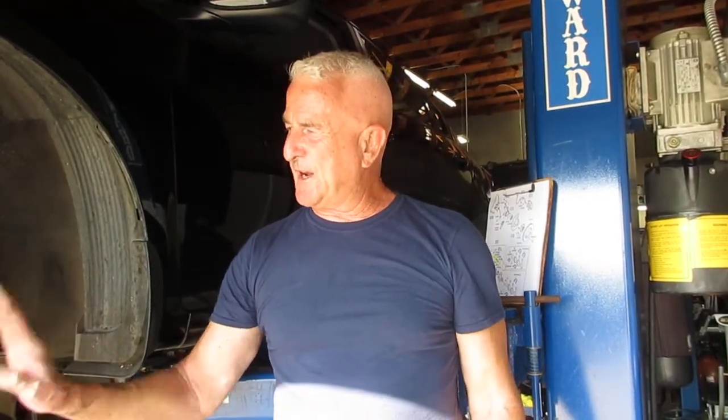between 8 thousandths with the one we took off, the one with all the hot spots and everything on it, the front and back of it all hot. The hub surface was all corroded, all rusty. We cleaned all that up. Cleaned up around the inside of the hub, bolted everything up, and we have a half a thousandth of an inch. It's just like amazing. That's what brakes and things are all about.